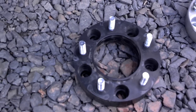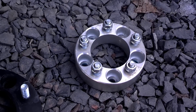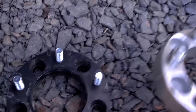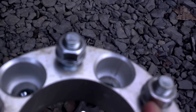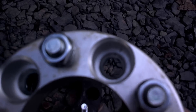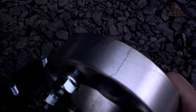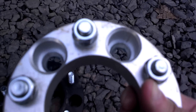Think about what you're doing with these — be smart, be safe. You do not want to buy your wheel spacers from eBay if you can help it. If you do, make sure they're made in the USA and make sure they have a lifetime warranty. This is a lesser expensive set from eBay that I purchased years ago for my Honda. As I was putting it on — and keep in mind, I never even got a wheel attached to this — I was tightening the lug nut to a hundred pounds with my torque wrench, no more than that, and I actually split the wheel spacer all the way through.